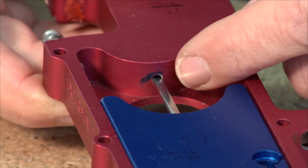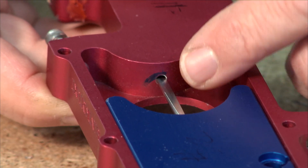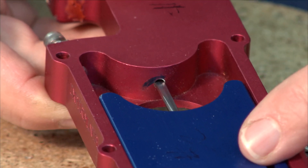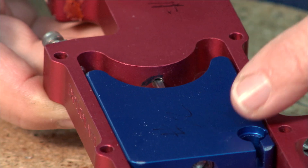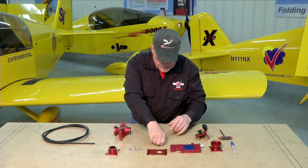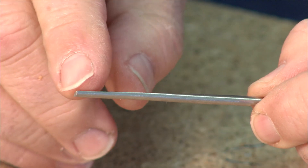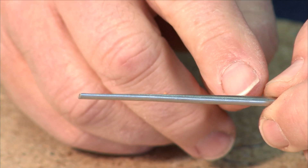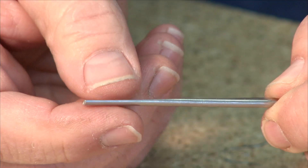So as the needle is pulled out, more and more of the taper is exposed, which allows more and more fuel to match up with the larger amount of air being allowed in by the throttle slide. As you close the throttle, the taper closes the fuel orifice, matching the fuel flow to the amount of air being allowed in. Here's the needle itself — just a tapered needle. It starts at full diameter, and then the taper starts at one end, getting steeper and steeper toward the full-rich end.